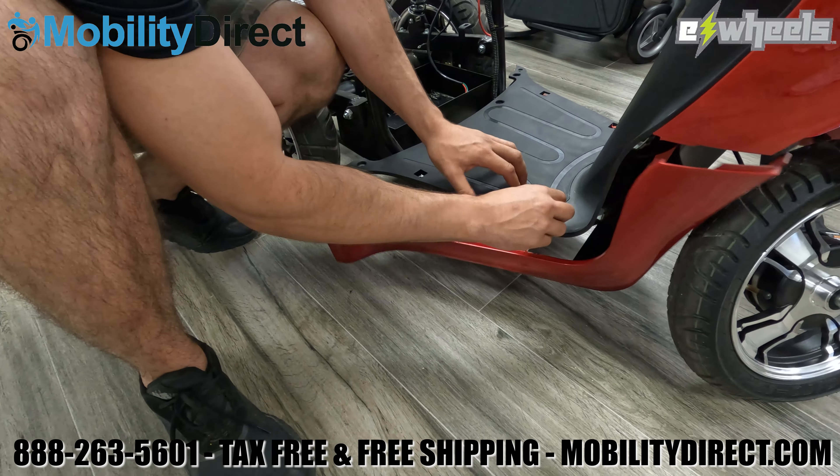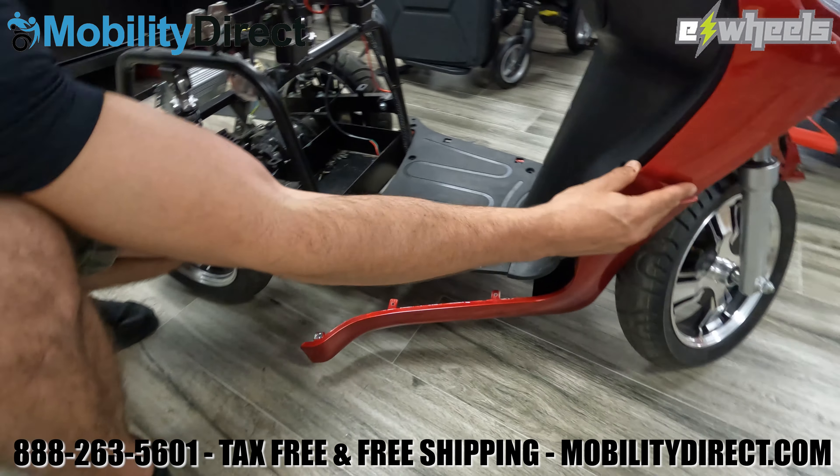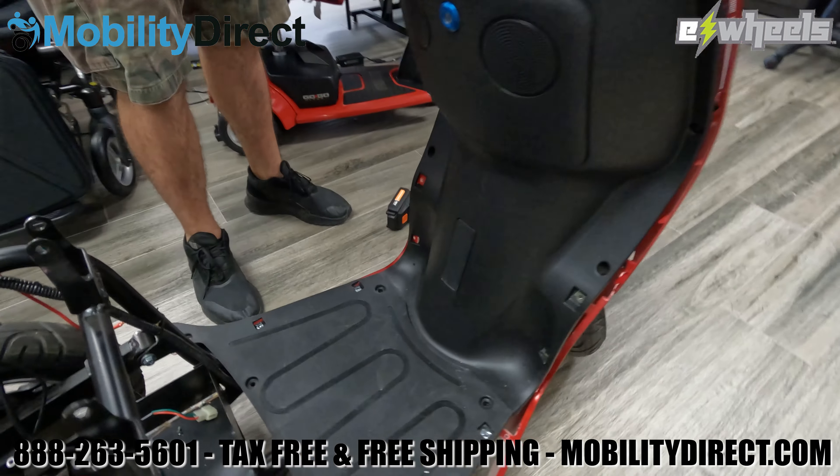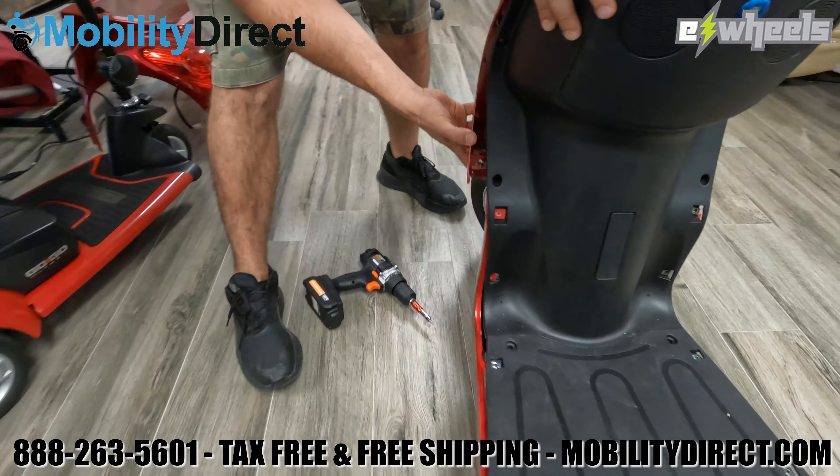All the clips have to slide out completely to be clear and free — the top and bottom parts do disconnect. There are some clips that hold it in place, and once you have it completely loose and on the floor, just pick the front wheel up, move it to the side, and now that bottom panel on the right and left side of the floorboard is completely free. One of those clips may fall out — just be careful and pay attention to where they belong. There are two lines on one side of the silver clip, and those two lines need to be facing up when you put the clips back in.